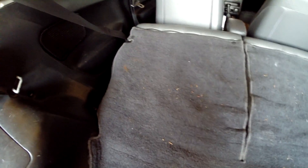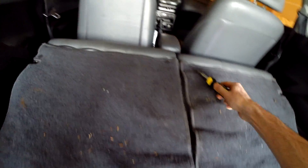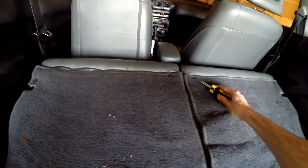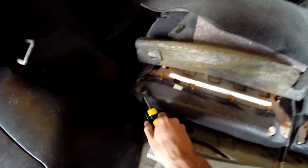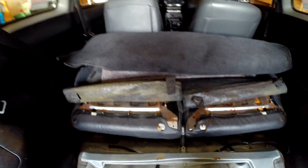Next, we're going to remove the carpeting from the trunk and the rear seats. This is just Velcroed to the trunk, so you can kind of roll that up. Then it's got these four connections here to the top of the rear seats — you can simply stick a screwdriver in and pop those out. Once you've done that, there will be four more at the bottoms of the seats and you can pry those out as well, and then that carpeting comes right out.